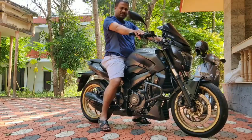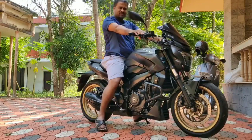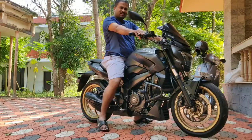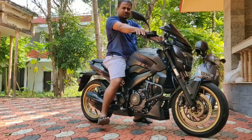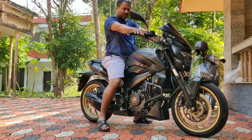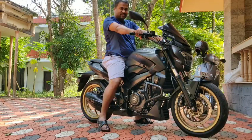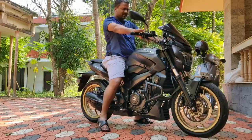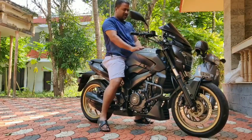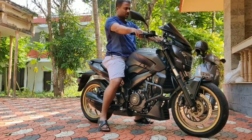About 10-15 days before, I gave the vehicle for servicing — basically for chain lubing. I do it every 500 km myself and every 1000 km I take it to the showroom so I can get any updates as well. The service guy told me I could try using the NS clutch cable because it seems to fit the Dominar. I asked him to change it, and he set it so I could tilt the handlebar slightly more towards me with no tension at the clutch cable level. Now it has come perfectly well.